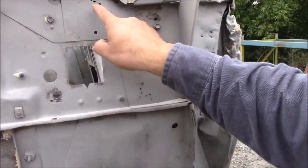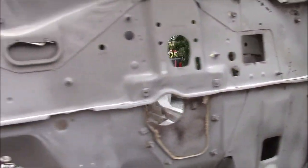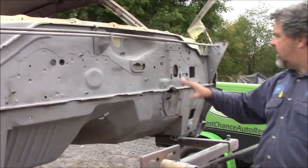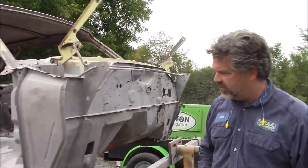You'll see there's some exposure — like a Swiss cheese kind of thing — a little bit of rust through, which we want to be able to see. A lot of people wouldn't clean it that thoroughly; they would just scuff it, sand it, and paint over top. There's body filler in there which we removed with the sandblasting media that we used.